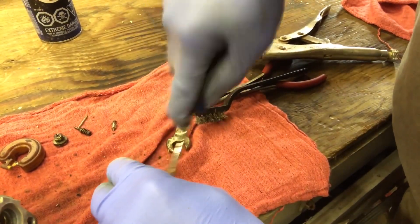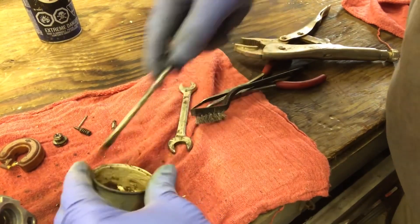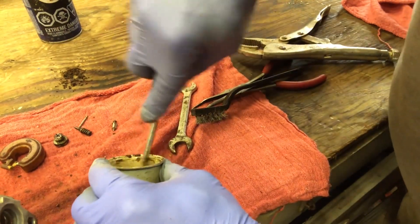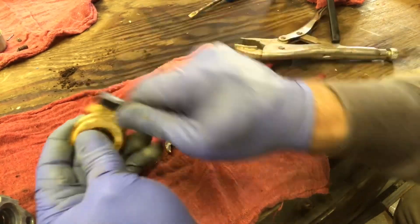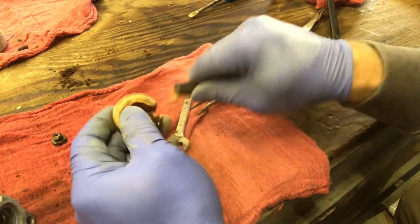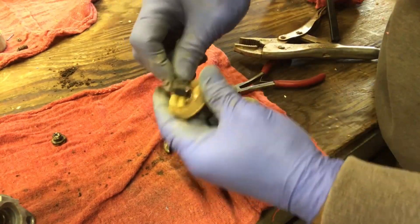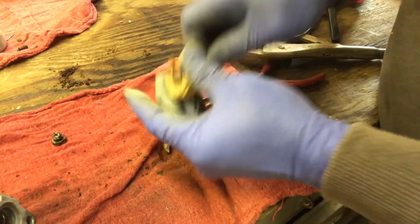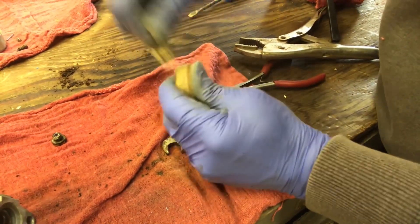So take a little bit of time now and make sure that it's very, very clean. I would probably recommend getting a carburetor kit, maybe even getting a new float, but I can't get out and get parts right now - so we're gonna try to just see if we can clean this up.